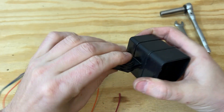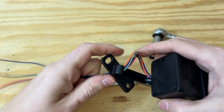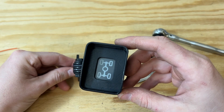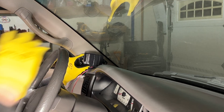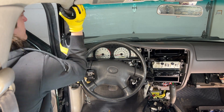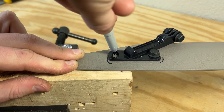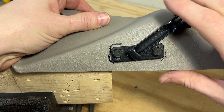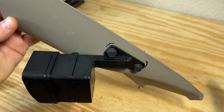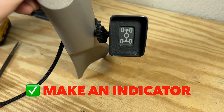After mounting the gauge, a hinge allows for left-right adjustment of the face. The mounting arm has a channel and cover used to hide the wires. Despite the gauge being a little clunky, it works and I'm pretty happy with the result. I first marked the approximate position where I want to put the gauge — it's much easier to mount the gauge with the A-pillar off the truck. Back at the bench, I marked and drilled the first hole, installed the first bolt, then marked and drilled the second hole. The slot in the mounting arm allows the up-down angle of the gauge to be adjusted. Step 4 complete — make an indicator.